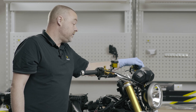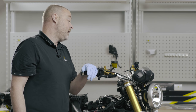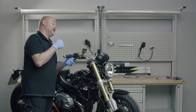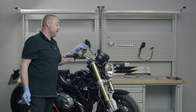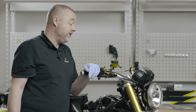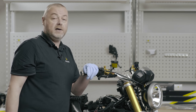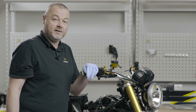So now we have our HC3 brake and clutch master cylinder mounted on the motorcycle, filled and bled. Now we have to put the motorcycle back together again and try our first test ride — always a good idea. Set the lever a little further out than you would normally use it for the first test ride, and then afterwards potentially re-bleed both master cylinders following the first test ride, and then set the lever position to your favoured position. I hope that the video has given you a bit of an insight into the world of HC3 master cylinders or Magura master cylinders. Should you have any questions, feel free to address them to powersports@magura.com. Thank you very much for watching.